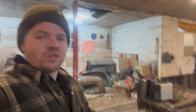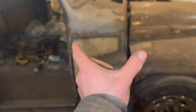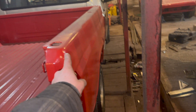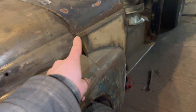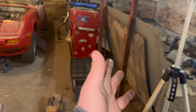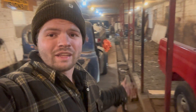When you're talking hot rodding and especially rat rodding, you don't have to buy new. I'm buying new for the convenience, but on a shoestring budget there's a lot of steel you don't have to buy new. We did reuse some on this truck — that panel there is actually 16-gauge steel we cut out of our long bed during the long-bed to short-bed conversion on the F-150. Pieces of bedside and scrap steel are all through this build.